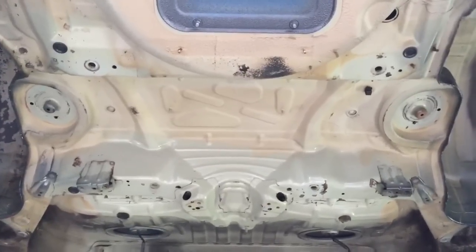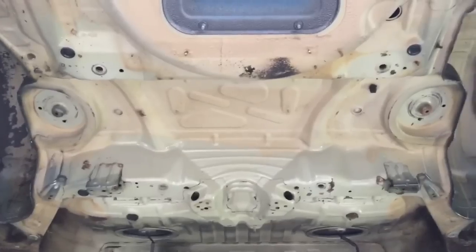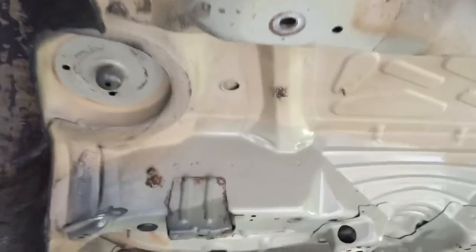Something that's fairly straightforward and standard, yet I think we're the only company that really do it to this detail. Just to make sure we're not going to miss anything, we can check for cracks and indentations in the sealer, which might suggest spot weld failures, exactly like that one there. Whereas before that was a little bit of an unknown, and it's quite clear that's failed.